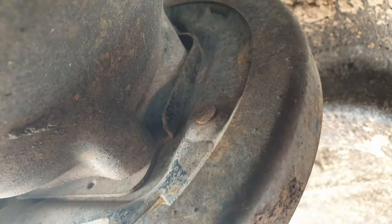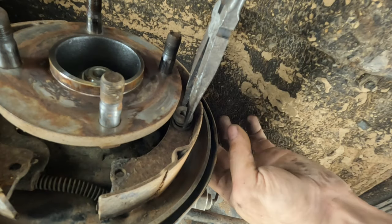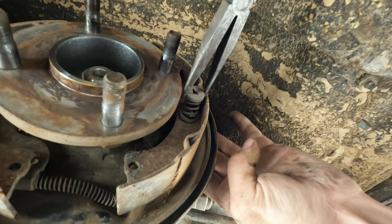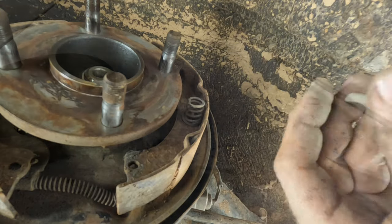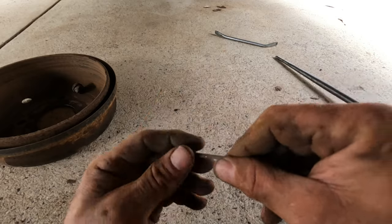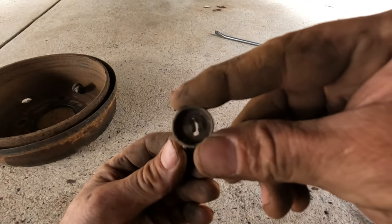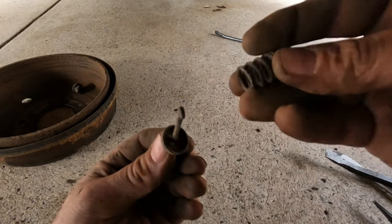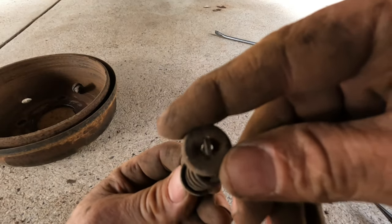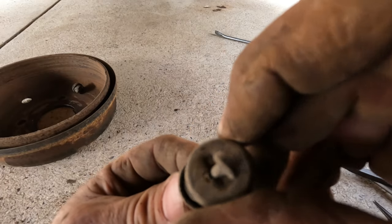On the back, I'll take a photo — I'll put it up. Just put your finger on it — there is actually a tool for this, but just use these pliers — hold that pin and we're going to turn it 90 degrees so that lines up and comes off. Here's a breakdown on the ground. That little pin will go through the back of the retaining plate, then through the brake shoe, and you've got these little retaining washers with a keyway that slides over. Then the spring that sits in there. What we're doing is pushing the spring down and then rotating it to pull that off.